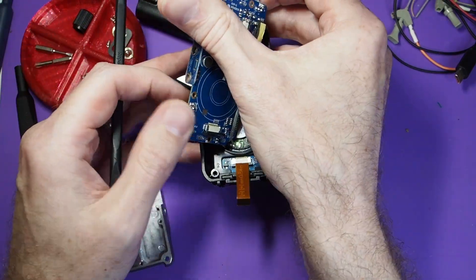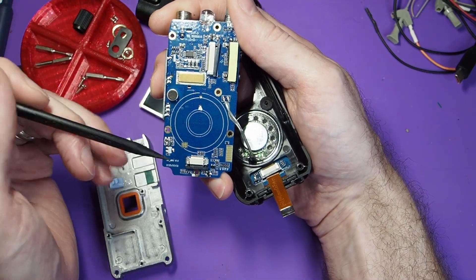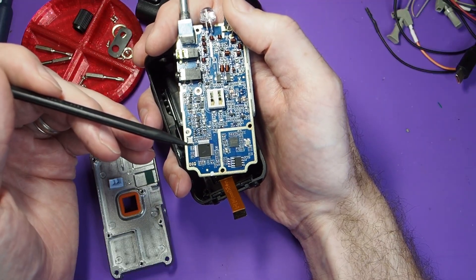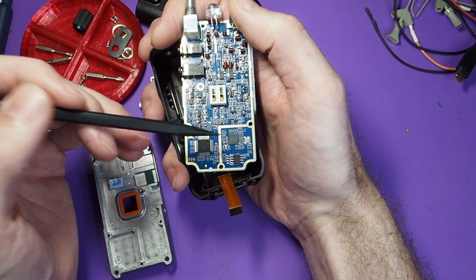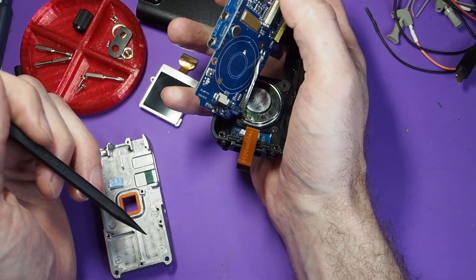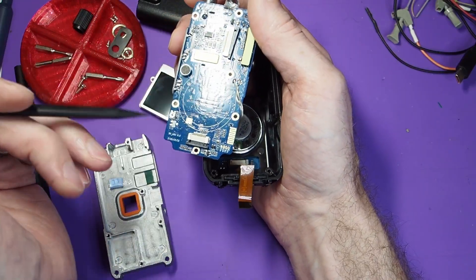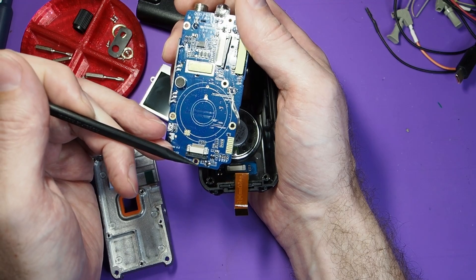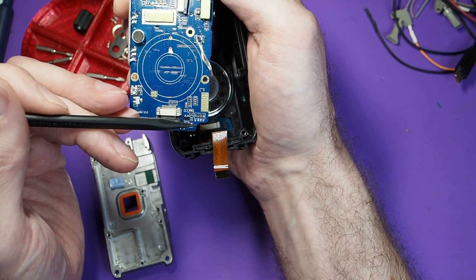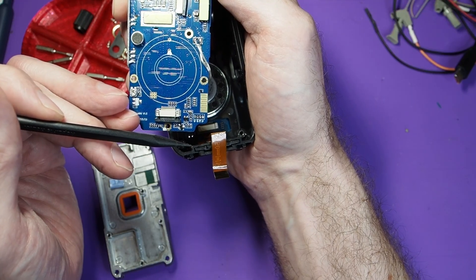This device does have Bluetooth built in, so you can use Bluetooth to send and receive memories using your phone — there's a mobile app for it. The onboard antenna is connected, and it looks like the Bluetooth is actually built into the main MCU, with the FD6818 chip handling only the high-power TX/RX transceiving. Also in that vicinity, there's a really interesting-looking debugger programming port labeled VGMP. V and G are confirmed as voltage and ground at MCU-level 3.3V, but M and P are not yet identified.